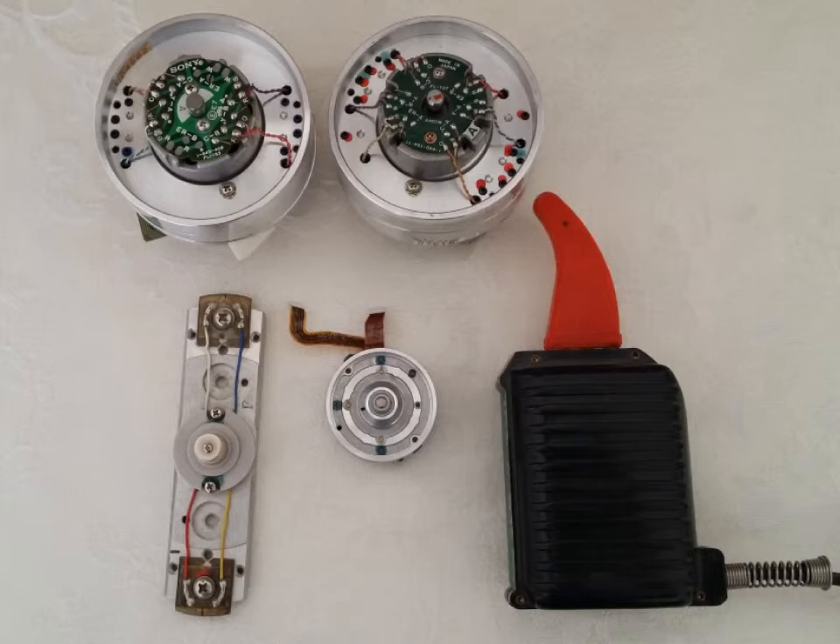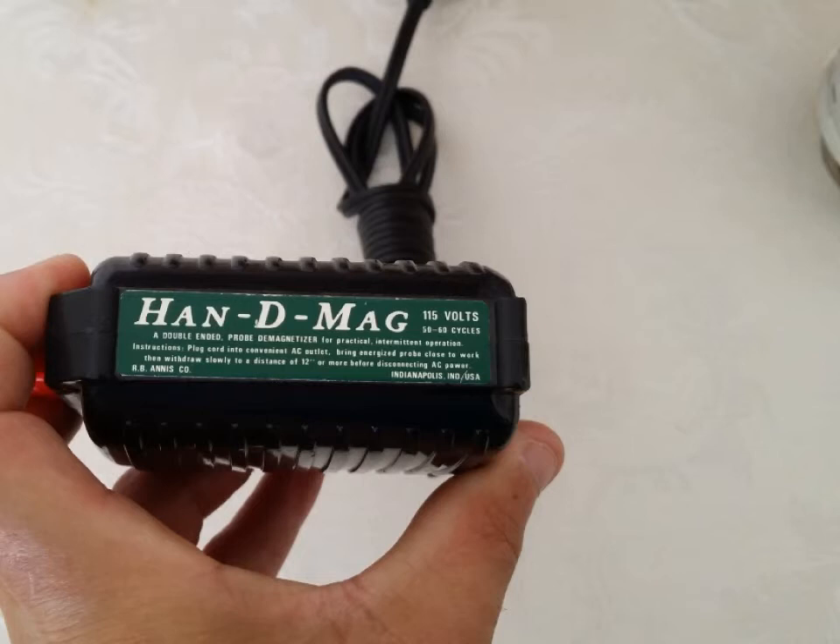Be careful not to break anything — be very careful when you're cleaning the heads and use good materials. Use good rubbing alcohol, about 90% if you can find it; stay away from water-soluble alcohols. Warning: do not use Q-tips. Do not press hard on the video heads. Clean the heads really well, blow out the gaps with an air compressor or spray can of air to get the gap free of residue. If you follow these instructions your heads will be really clean between each tape and you'll have a clean transfer. Also, replace the video brushes if they're bad, because you'll get a lot of video noise in the picture.